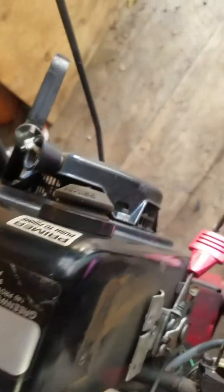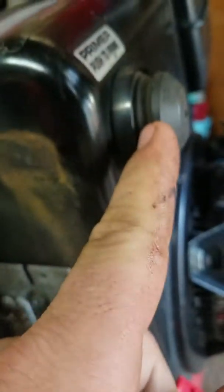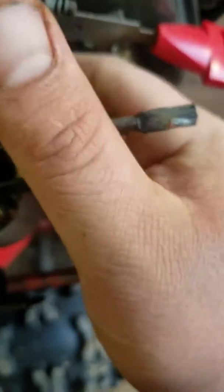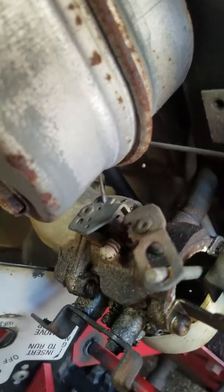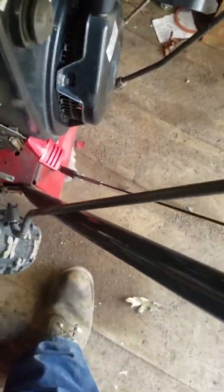I'm just going to put that out of my way so I can still work on it without having to unhook it. There's the carburetor. First thing you want to do is pull off your primer — that's up here, pull that off. Next is your fuel line, and by the looks of that clamp it's broken, missing the piece — it just fell off. Then you've got one bolt there, another bolt on the inside, and your linkage here. Remember where your linkage goes because there's a couple different holes you could put it in. I usually mark it with a little paint marker right by the hole where it goes.